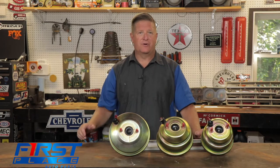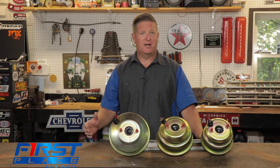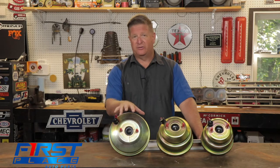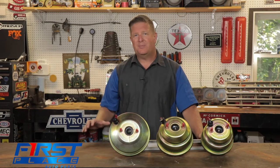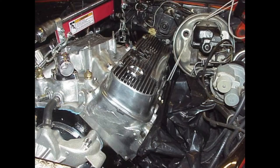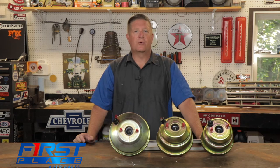The original booster on a car that had a front disc brake rear drum setup from GM would have typically been 11 inches in diameter. This 9 inch is actually smaller but similar in design to the original brake booster. On Big Block Chevrolets, especially with certain engine and body style combinations, there just is not enough room for an 11 inch booster at the driver's side rear corner of the valve cover.